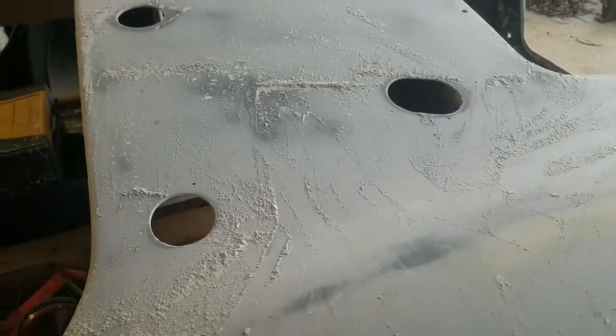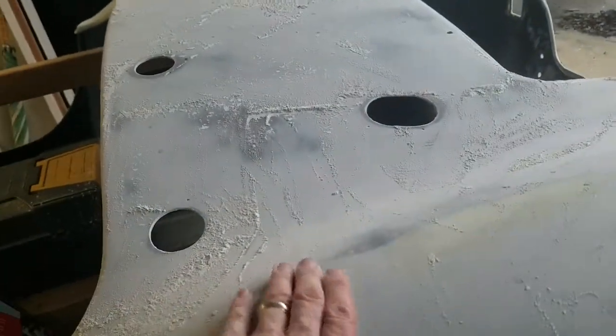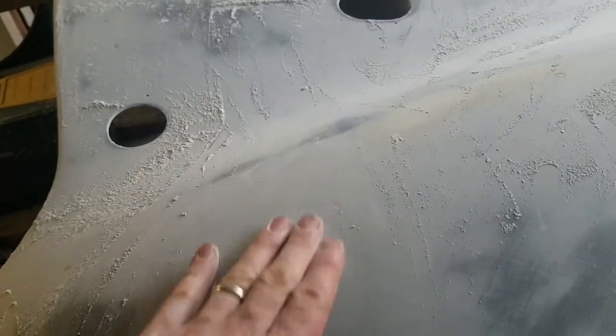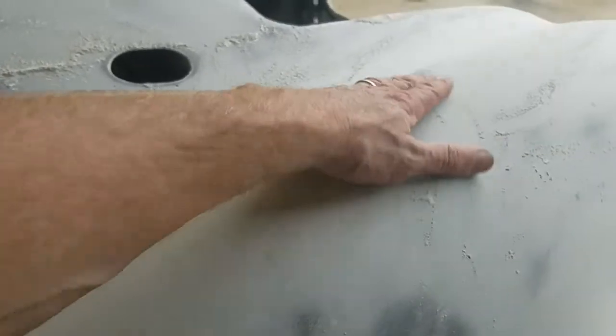It was just an oddball. So I've tried to sand it all down to where it's all, you know, I really don't know what the term is. I'm going to call it in plane with one another, and that's what I've done. So the 80 grit's going to be covered or gone back over with 220. You can still feel some of the ridges that were in here. It's not bad. I mean, it's got some good curves to it.